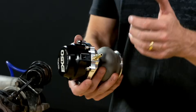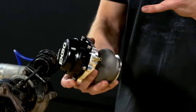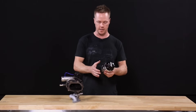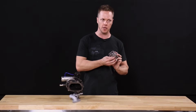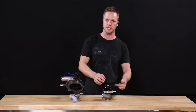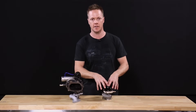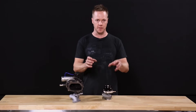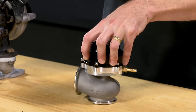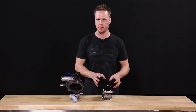One good example is on a drag car using two-step launch control. There's so much popping, banging, and backfiring in the exhaust while you're on the start line that it generally tends to blow the wastegate valve open. What a lot of racers do is apply CO2 from a bottle to the top of the diaphragm to hold the wastegate shut. So while you're sitting on the two-step with all the banging and popping, you can keep the wastegate shut to ensure you get maximum boost for launch. Then when you relieve the CO2, you can start controlling boost normally.